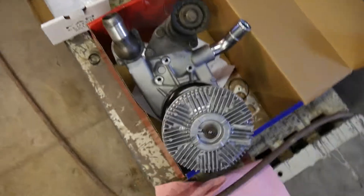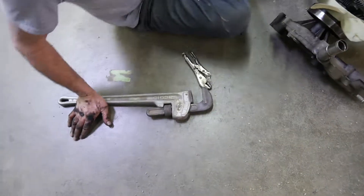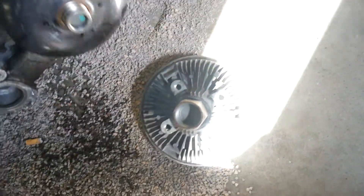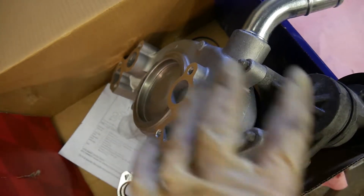We got the water pump out. Got the new unit starting to look good and it's about to go in. The housing and the thermostat are in. Idler pulley's on. Now we've got to get the clutch fan on — we're trying to work on it because it's a pain. We got the fan off the old unit by putting a vice grip in, locking it down really hard, and then using a big pair of vice grips to take them off. The new one has all its components on it ready to go, and we're going to put it on once it's in the car. We're going to put the bolts through these holes, set the gaskets on them, and then put the part inside the car.